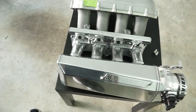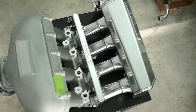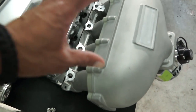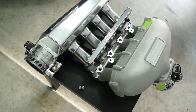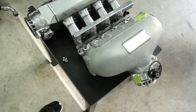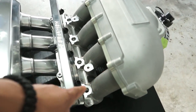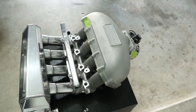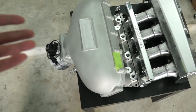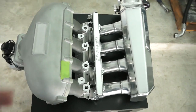One thing to consider when looking at pricing between these two intake manifolds — or any of the large intake manifolds — is that the majority of large manifolds actually come with the manifold itself and the fuel rail included. Whereas Skunk2, all you're going to get is just the manifold by itself. And since the Skunk2 manifold has a smaller plenum, if you want the same plenum volume as a K-tune, Gato, or Hayward manifold, you'd have to buy extra plenum spacers as well as a fuel rail. So the Skunk2 price seems really cheap at first glance, but once you factor in everything else, you see where the price difference — or lack of one — actually lies.